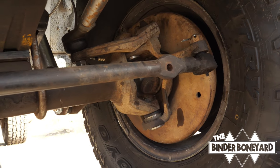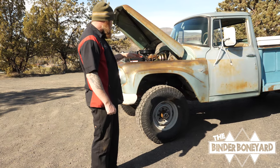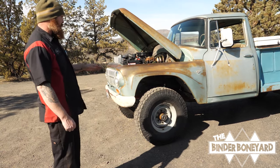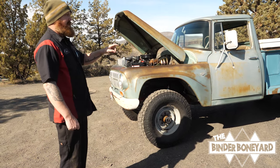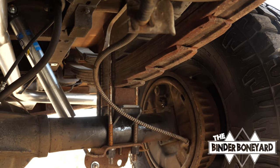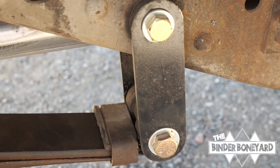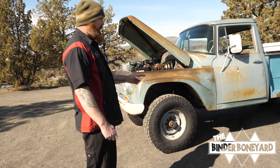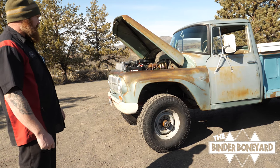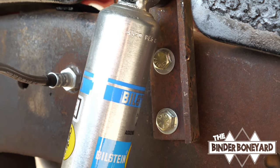Going from two-wheel drive to four-wheel drive, the springs are already in the rear-most position. Adding the front axle was about a four to four-and-a-half inch lift on its own. In the rear we just added the factory International four-inch suspension lift block that came on the D-series truck. Running 35s, this truck just has a five-inch shackle at the rear of the front spring and the factory four-inch lift block in the back — no additional spring lift at all. You can get 35s with just that simple modification, and it has Bilstein shocks that ride super great.